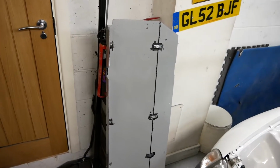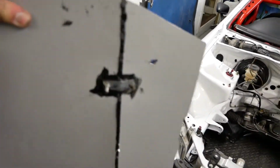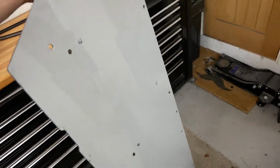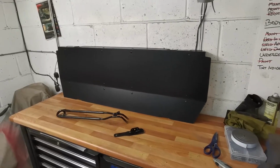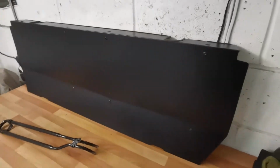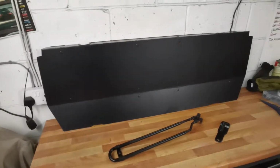And you can see I've taken off the rear bulkhead panel that I've made. I've just rounded off the corners a little bit, stuck a bit of Bond down the seams, hopefully strengthen it up a bit, and behind the brackets as well. Gonna throw some vinyl at it in a minute and then rivet the brackets back in, so it should match the door cards quite nicely. Threw a bit of vinyl at the rear bulkhead. I'm afraid it is an absolutely hideous job, but with any luck you won't be able to see the imperfections once it's hidden by the seats in the car and everything.